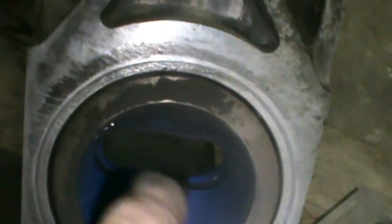You're pretty much just taking the opening to the edges of those lines, and then you put that little two millimeter taper all around the edges so it's easier on the apex seals. You can't have a sharp edge - pretty much the same thing as with the intake ports. You can see down here there's not a lot of meat at the bottom where the exhaust insert is. Pretty much what I did with my last one - just bring it down close to that but still leave the overlap from the insert, just bring it down on the taper to the edges. For the exhaust ports you want them as smooth as you can get them - if you can get a high polish finish it'll just slide on out and you won't have as much carbon buildup problems, and it's better for the turbo.